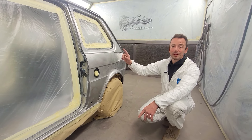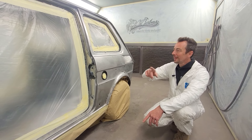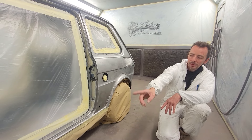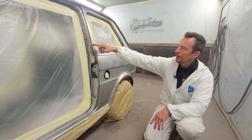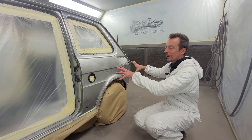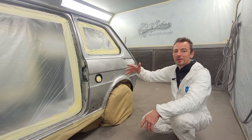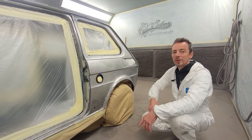Luckily, you can get completely genuine rear quarter panels, which are on order and hopefully here tomorrow. As soon as they arrive we can start cutting this thing up and replace all of this with one genuine big panel that covers the sills. We'll probably end the panel at the front of the sill — all the front metalwork is still good so it's pointless messing with it. Time to get this thing into high-build epoxy to protect all the bare steel, then block it all back.